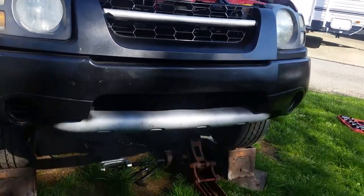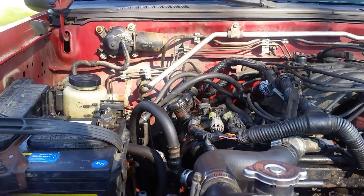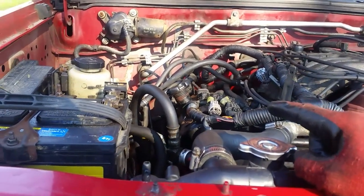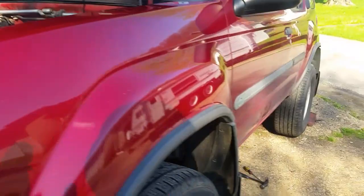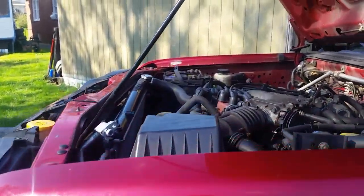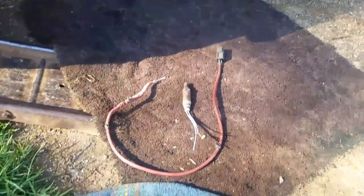It's been about a week, and I've got the two oxygen sensors on that side done — it seems to be working okay. Now it tells me that the catalytic converter is bad on this side — I have a P0420, which I'm not surprised about. I always get vehicles with bad catalytic converters. In order to do the O2 sensors on this side, you stick an extension down in there and you can break that loose. That side's been done. And here's the old rear O2 sensor — I basically just cut it off. Looking at it, it doesn't look like it's running too rich, although there's a little black there. I'm hoping it's just a bad O2 sensor.